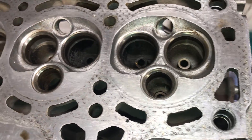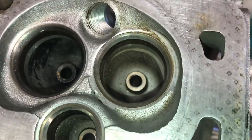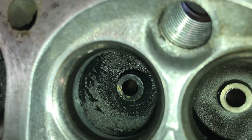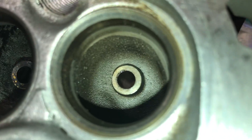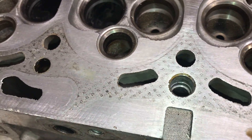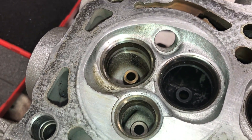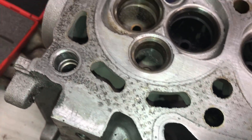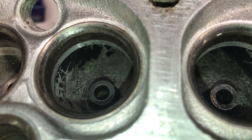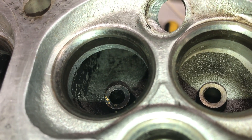So it's been a few days. I have cleaned the cylinder head — given it a bit of a preliminary clean out, most of the carbon is gone, it could do with a bit more. We're going to get in here with a die grinder and remove some of this casting flash before the engine goes back together. The gasket surface looks pretty good — I've just given it a bit of a scuff with a very low abrasive pad. You don't want to introduce any more scratches. The valve seats look pretty good — that's an exhaust one there, that's another exhaust one. They will lap up just fine.